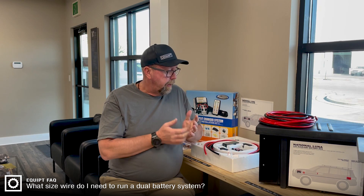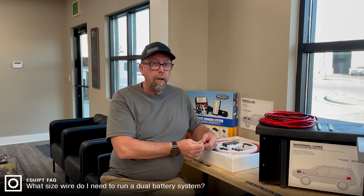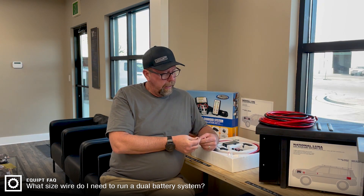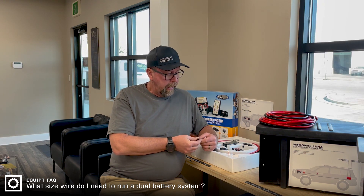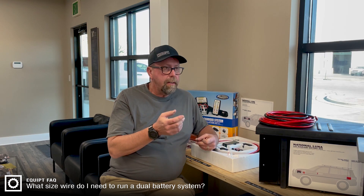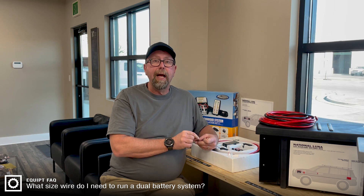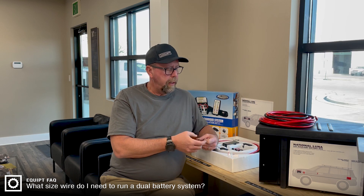The wire that they use is a 16 millimeter squared, which is awesome if you're in a metric country. What that means over here on our side of the planet is that this wire is just shy of a four gauge wire. It has a sheathing on it that is impervious to the elements — it's designed for automotive use — and has a silicone core insulation that works well. And then a very high thread count on the verge of a welding cable thread content, not the size of a welding cable, but pretty close.